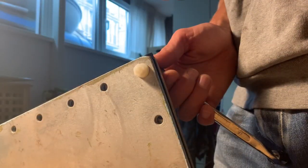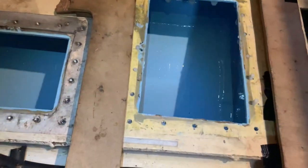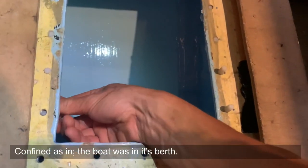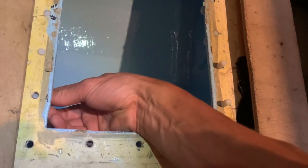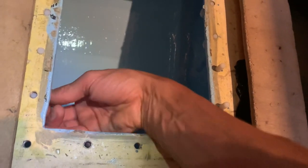I couldn't even make it up to three newton meters, but I still figured it would make sense to use nylon bolts — the water tanks are mostly not full, are not constantly under pressure, and they have 24 bolts per section. So I gave it a try. I'm actually continuing with nylon bolts in all of the water tanks. I need to put water in for two days, which I can do in a controlled way to minimize risk. I can see how it stands up, if it leaks, and I can always switch back to stainless ones. The final task to get the water tanks ready for use was cleaning them with a drip of cleaning soda.